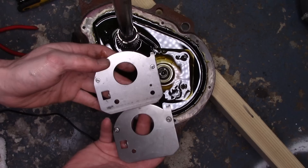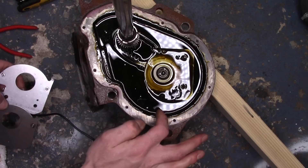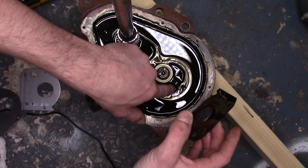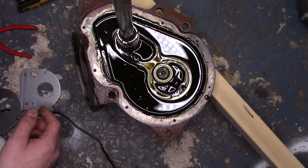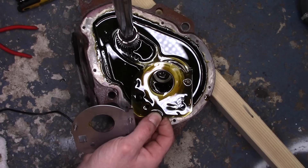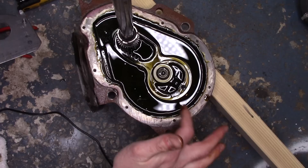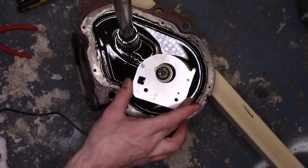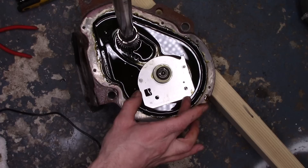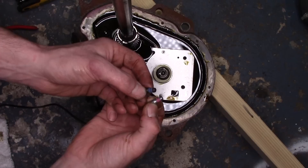When you get your new neutral gear pack, you'll get two separate base plates because there are two different styles of neutral gear packs. There's a way to check by looking at one of the gears at the bottom — it will have an X on it identifying which type it is. But the simplest approach is to just look at your old one and match them up. This one has two holes here and this one does not — this is the identical match to what I'm pulling out, so this is what I'm putting back in. If you want to be 100% sure, you can check the big gear underneath the oil: if there's an X on it, pick one plate; if not, pick the other. Also, this neutral gear only goes in one way — this hole will never line up incorrectly, so it can only be positioned one way.